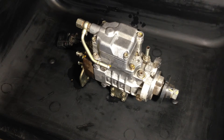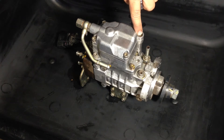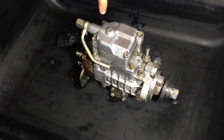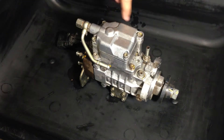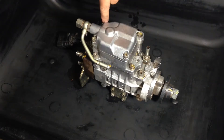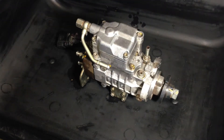The way I heard guys do it, you need a 12.7 millimeter socket. I looked around for one and apparently I don't have one of those, so this is gonna be kind of a sketchy process removing this one bolt. I'm not gonna show that part. We're gonna start by removing the top — there's three screws and a safety screw up here, and then there's three more screws down here. We'll be using Torx 30 for these.